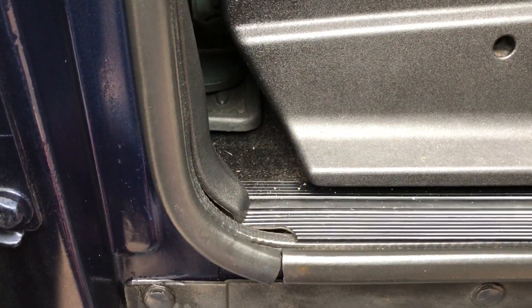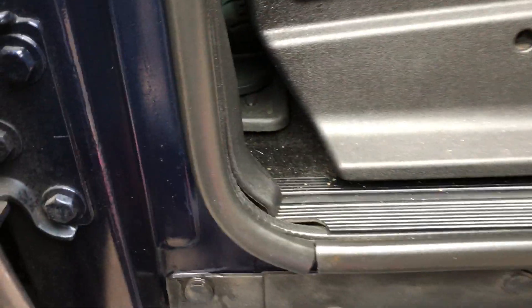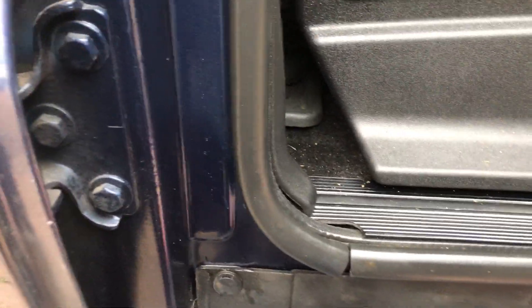As you can see it does make a cosmetic difference as well, and this will nourish the rubber and stop it cracking — especially useful if you've got older vehicles, old rubber parts on suspension parts, things like that. Or if you've just fitted something, you can just maintain it and stop the rubber from cracking so it lasts a bit longer. That's it really.